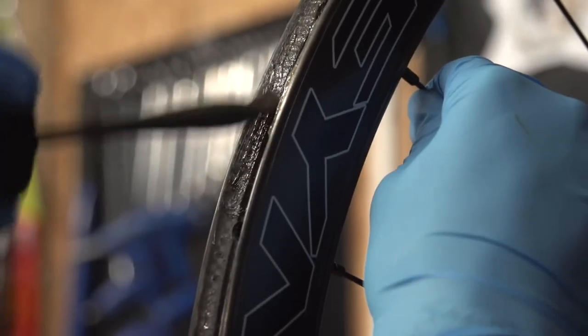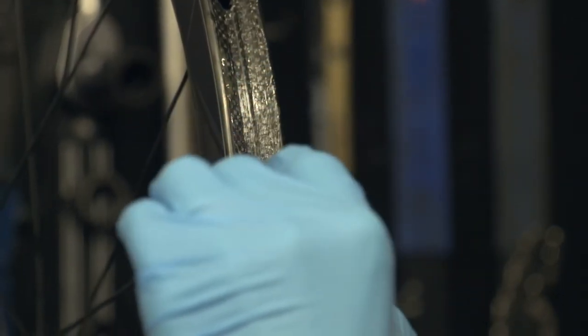I think as you suspect by asking the question, using a heat gun such as what you'd use on wallpaper could potentially seriously damage your rim. The other thing to bear in mind is how the tub glue works — the tub glue contains a solvent, and when that cures and sets, the solvent evaporates and leaves the adhesive behind. So melting it isn't really the best way. Unfortunately, removing tub glue is a pain. The easiest way that I've found is by using good old elbow grease and also some solvents such as rubbing alcohol, petrol, or white spirit. If you're worried about the solvent damaging your carbon rim, which is a sensible thing to be worried about, just get a bit on a cloth and try it on a smaller area first and see how it responds. But generally speaking, most rims should be okay with white spirit — maybe just check first.